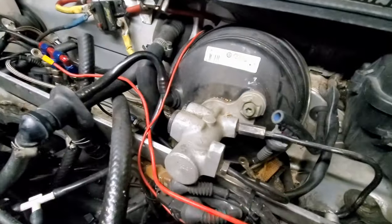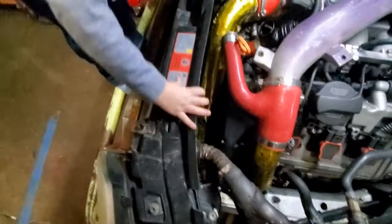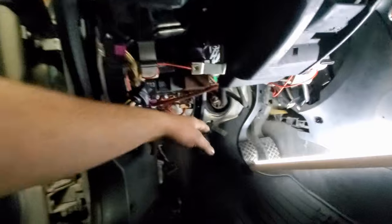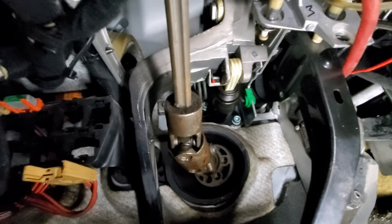So where we stand right now is that the brake master cylinder reservoir is off. I've got to take those two bolts out, but before I do that I have to get inside the car and take a few things out. So to get down where we've got to go, you've got to take this cover off that's down here — it'll be like a handful of screws in there. I've got to get this bolt and that bolt out right over there. I know it's going to be a pain, and I know I don't have the necessary equipment here to do it.